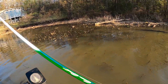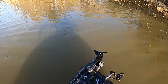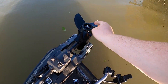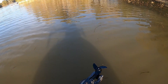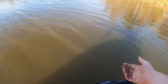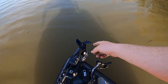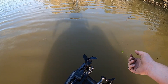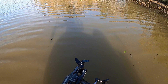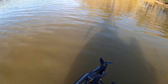Sounds like we sheared the pin in the trolling motor — that's what it sounds like. Y'all can see that center shaft but it ain't moving. As you can see, I'm spinning the prop freely. It appears when I went up into that thick stuff, I either knocked the pin on that shaft that goes into the trolling motor blade out of place, or I sheared the pin. Regardless, I don't have the tools with me out here to fix it. I probably should keep a spare pin and something that'll fit that bolt size on my boat. But as it stands, that right there is going to cut our fishing day short — it is what it is.